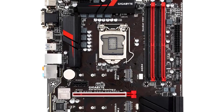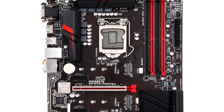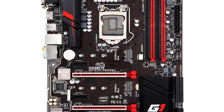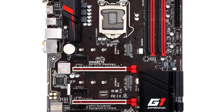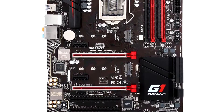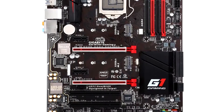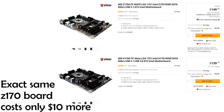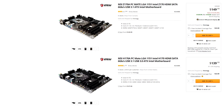Next is the H170, which is essentially a Z170 without overclocking capabilities — same size, often the same features. I recommend H170 only if you're not looking to overclock and running a non-K processor like an i3-6100 or i5-6500. The Z170 is on average only about $10 more expensive, and there are times they cost essentially the same. For that reason, I really don't recommend H170 unless you're absolutely sure you have no interest in overclocking — it saves you at most $10–$20.